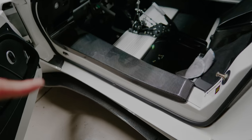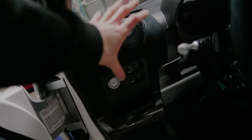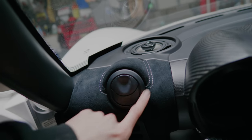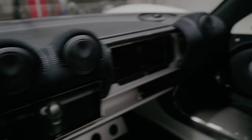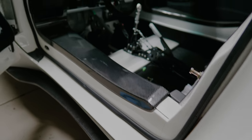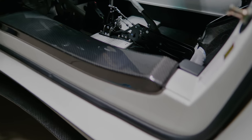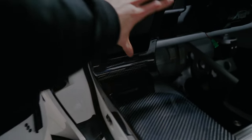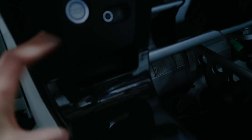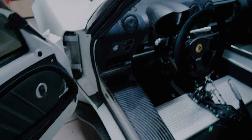Let's check out the interior. Both door sills are now installed, left and right, and I also installed the left and right vent pods. The door panels were also rewrapped and upholstered in Alcantara with some custom stitching done in the spirit of the Cup Exige cars — I think they came out awesome. The fact that everything lines up basically like factory is a testament to the quality of these parts. Even the weave direction matches my side skirts. The only difficult part of the door sill installation was where it connects to the trim panel, because the carbon fiber piece is a lot stiffer, so you really have to maneuver it into that pocket area — but it did go in and everything bolted down nicely.